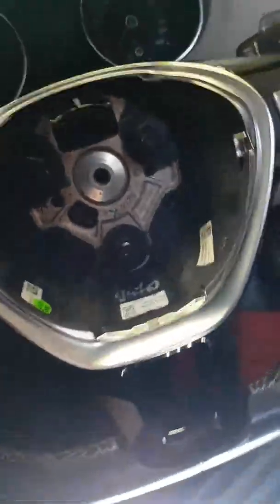If it's the first time the airbag's been off, then you may not see it straight away. But there's a little hole there and you're gonna have to get your tool and pierce through that little piece of vinyl to get it to go through and undo the clip.